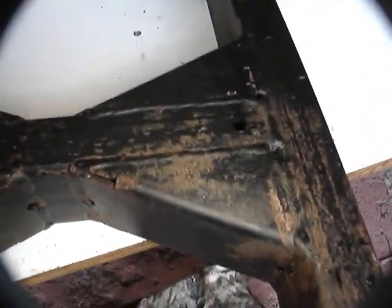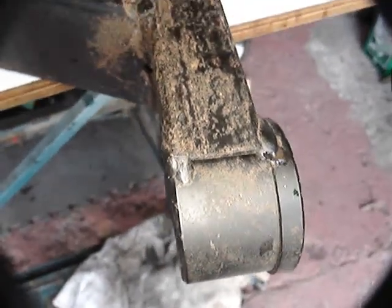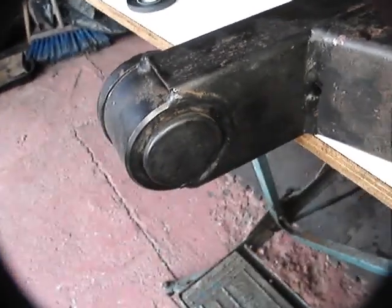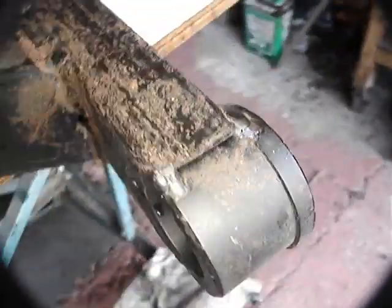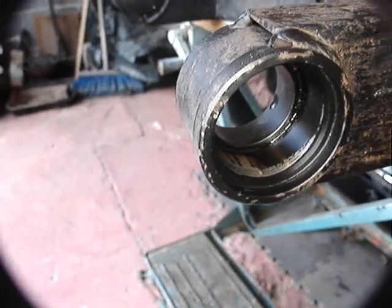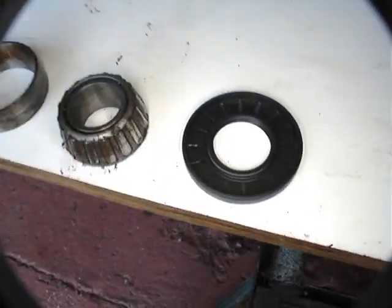The first thing we notice is that the corrosion resistance coating is very poor over the whole vehicle - in my opinion it's just not doing the job at all, so I'm going to give this one a coat of paint. We also noted when the swinging arm was still in the vehicle that one of these plastic plugs was missing - it was the one on the near side, the left hand side of the vehicle. I have removed the bearing, which is a taper roller that just comes out from this side without too much trouble. You'll notice the corrosion resistant coating wasn't removed before the bearing was put in.